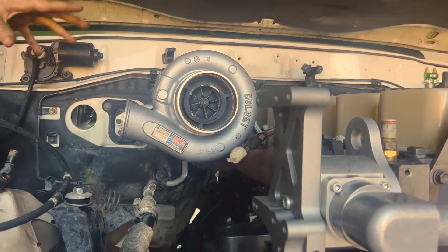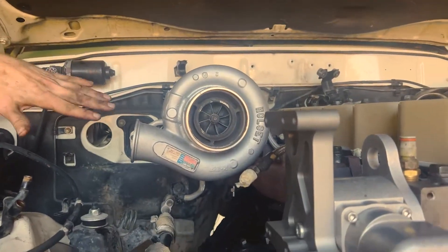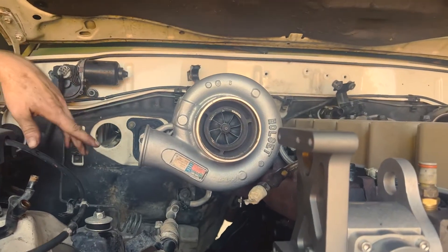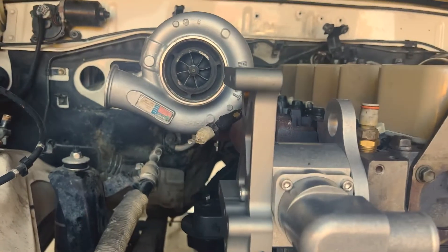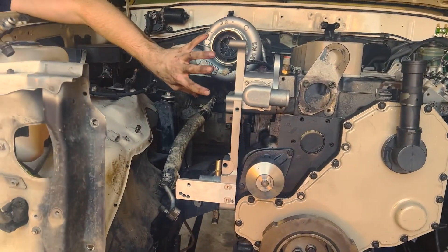We just think it looks a little bit cooler that way. We're gonna have to figure out a little bit of intercooler piping here, but I think we have all we need — and if not we can get more silicone. We'll just have a 90 here going down to the intercooler piping that we did in that previous video, where we drilled through and welded into the crossmember.